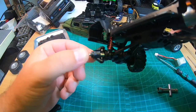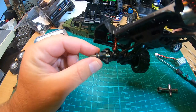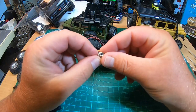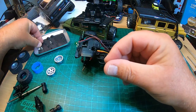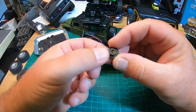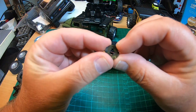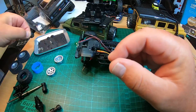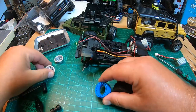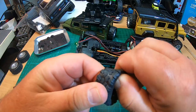Dog bone style steering with metal cups — check that out. The tires are mounted by huge screws and nuts. On the axle sits a 7mm hex, held by a pin, with a kind of brake disc — looks quite nice. Tiny beadlock rims, quite nice. But the tires are not super soft and sticky — they are quite hard.